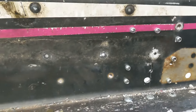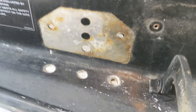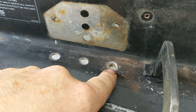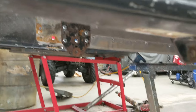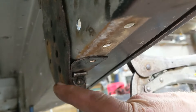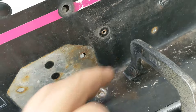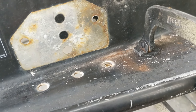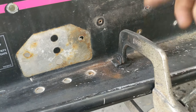I didn't go exactly 23 inches — it ended up more like 22 and 15/16 inches. The reason is this hole here is where the old plate was mounted. If I lined up my mounting plate for the skid with that hole, I could put one rivet in and kind of hold everything in place, and it puts me at 22 and 15/16 — so I'm like a 16th of an inch off. Close enough for my tolerance. So let's throw a rivet in there, drill out the other holes, and then drill out our mounting hole after we get the plate all mounted up.